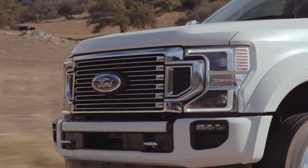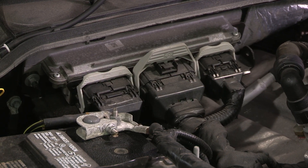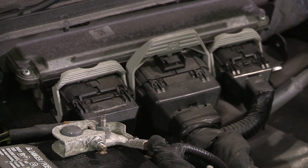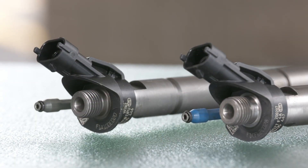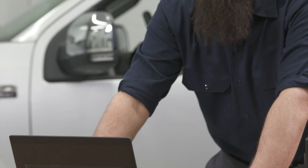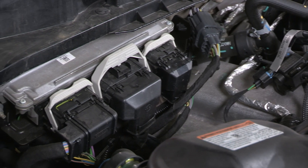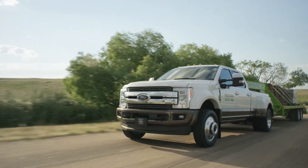This critical performance feature is not available on other aftermarket remanufactured fuel injectors — you can get it only with Motorcraft. The engine's powertrain control module, or PCM, updates the IQA code to adjust the injection quantity to the exact amount defined by the engineering standards. Any deviation from the exact specified flow rate volumes are corrected using an IQA code assigned to that specific reman fuel injector. No aftermarket manufacturer has access to these OE specifications and injector calibration procedure. Once installed in the engine, the PCM then adjusts the firing of that injector accordingly to ensure the correct amount of fuel is injected in the engine cylinder for optimum performance, emissions control, and idle stability.